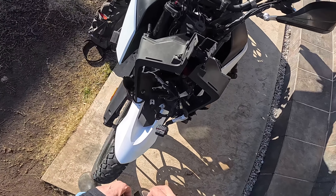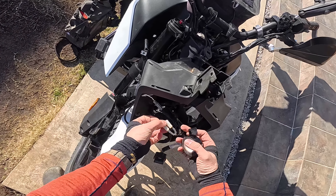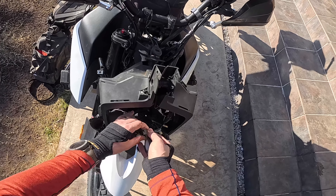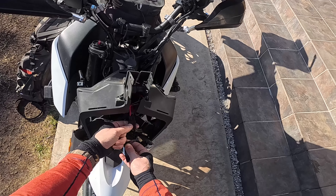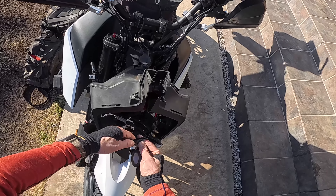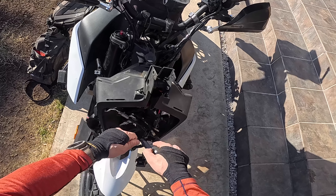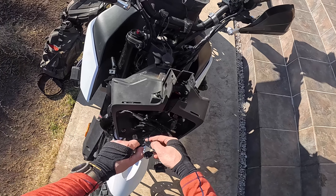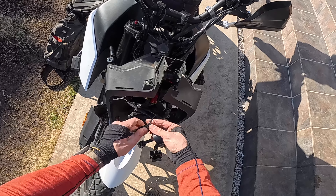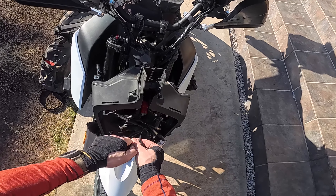Now that I know I've tested it, when you're doing electrical stuff, make sure you test this stuff out before you button everything up. Because if you mess something up, you've got to rip it all apart again — it's just not fun. So let's get this taped up so it doesn't short. I'm just going to stack that. Also, what we're doing here is preventing the connectors from getting removed. These connectors tend to sometimes get dislodged. Not too worried about it being back here behind the headlight, but still, just want to make sure — just insurance, because you don't want to have to break this stuff down and get in here and do this as many times as I have. Because you're going to start stripping screws out. It just happens, unless you're really careful. I sometimes get impatient, and that's a lot of the reason why I end up stripping things.